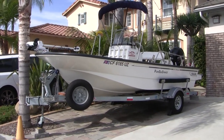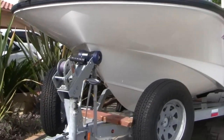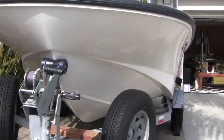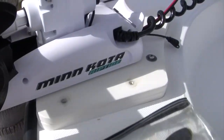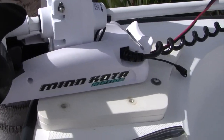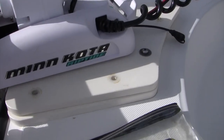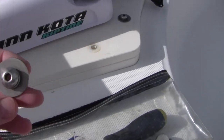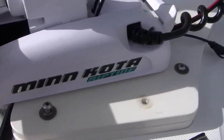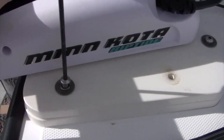Let me start the video on the most frequently asked question about our Montauk: the trolling motor and how it's mounted. Up front you can see we do have two spares, which come in super handy when we're traveling down to Baja. The trolling motor is attached to the boat with this custom three-quarter-inch marine board mounting system. There are actually two pieces that are identical in shape, and it simply attaches with seven stainless steel fasteners — a pretty big hex-head bolt, a large fender washer on top, and a locking washer — and they just get screwed into the bottom piece with a hex driver.